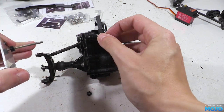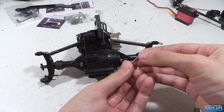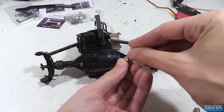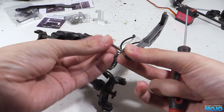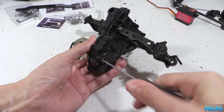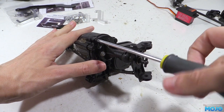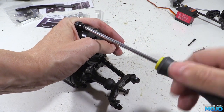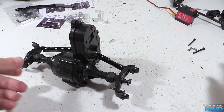So that's the old servo mount off. We'll replace the long axle brace so it'll match the rear axle. We need to be careful keeping track of the washers and spacers — there are three with flats on that we really don't want to lose. The rear end of the upper mount comes off next with its long screw, spacer, washer and nylock nut. Because the new axle braces use one of the screw holes that attaches the axle tube to the gearbox we're going to have to split it. The motor needs to come off with its two screws. Then we work around the outside removing the other screws holding the halves together, keeping an eye on the nuts. I'm starting to think those mismatched screws on the axles are really starting to let it down — we might need to get a set of stainless screws to replace the last of the old Tamiya fixings.